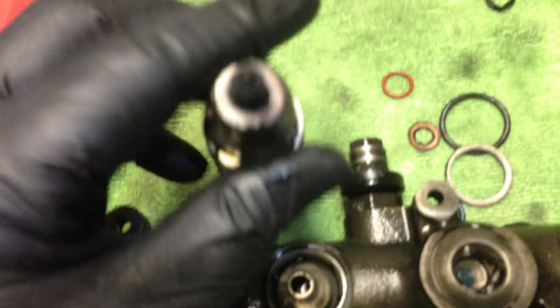You're probably better off just replacing this every time it goes bad versus replacing fully functioning injectors. The only reason you would lose power is because of this o-ring right here. Another reason you would lose power is because that copper ring gets worn out and doesn't seal properly. Another reason you lose power is the tip being all full of soot. So cleaning it up, it's basically like a brand new injector.